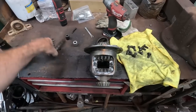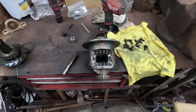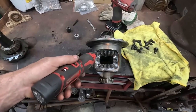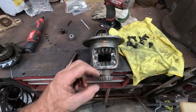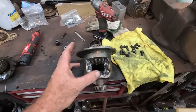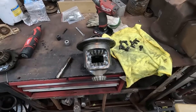Whatever you do, do not weld your pin to anything, because you'll never get your axles out if you are welding in the car. What I did is I welded everything. I took my die grinder and got all the little crumbs off, the slaggy little balls and garbage off your weld. If that splatters around and goes through your gears, you're in bad shape.